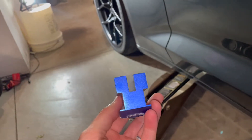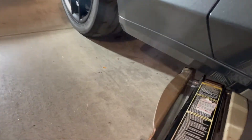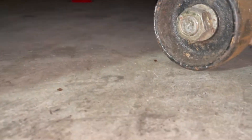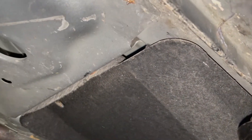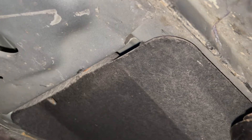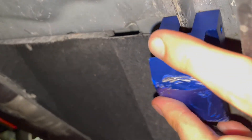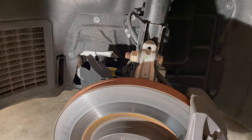When I jack up the car I like to use one of these jack pads — it fits right underneath here and helps prevent damaging the underside of the car when you jack it up. It fits right in between those two pieces, pushing out more against the frame so you won't bend anything. Alright, so we got the wheel off.